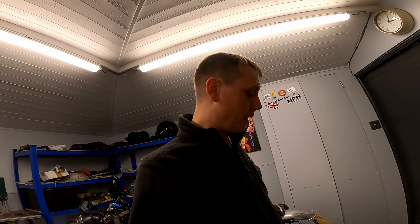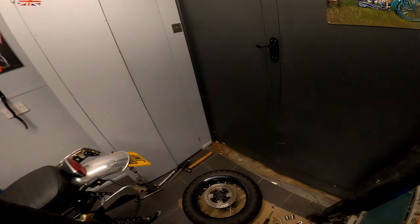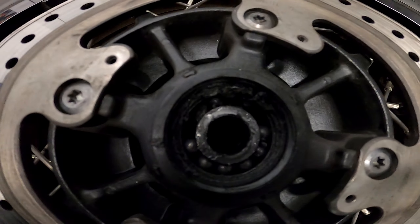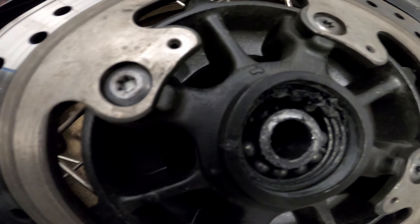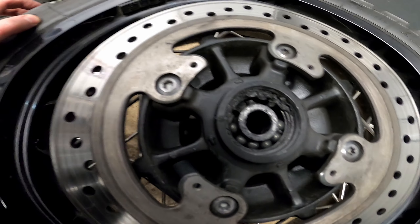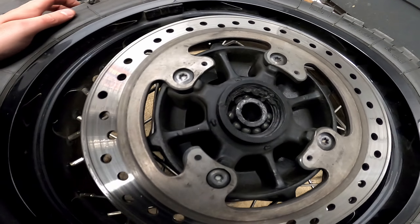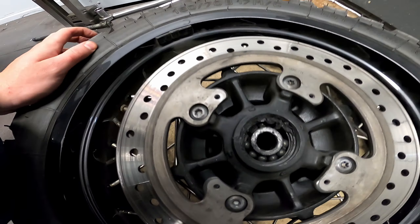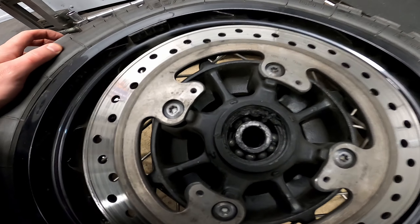As is apparent, got the wheel bearing seal out and yeah, it's pretty bad. We've got a number of rollers or ball bearings missing and there's definitely a crushed one in there amongst other things. We'll get this all cleaned up, get the circlip out, and then we can start taking the bearings out.